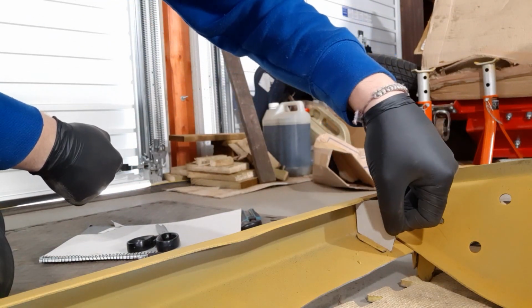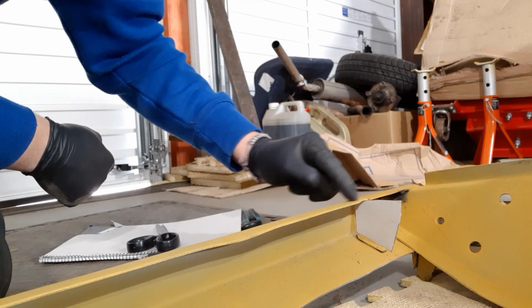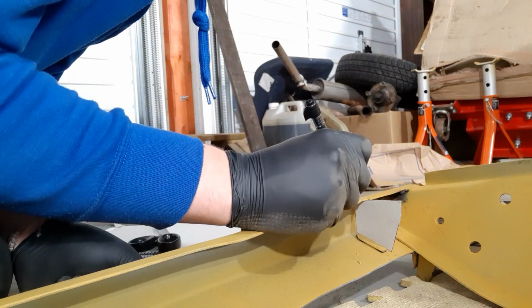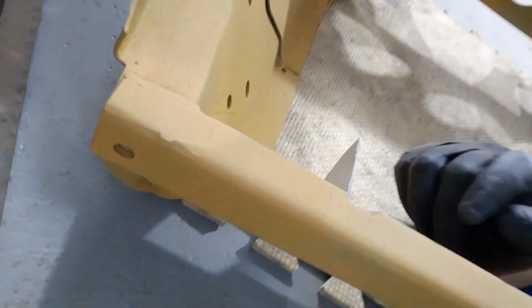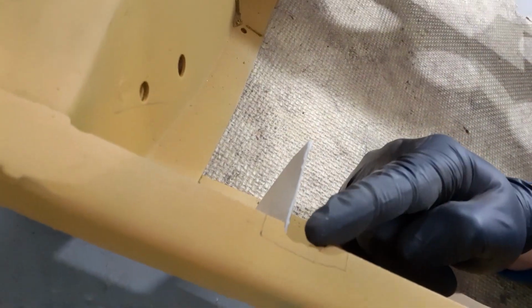So I'm going to cut some metal to this size. I'm going to cut out a section here, mark it out with this pen. So you can see this is the section I'm going to cut out and then replace, because that's obviously broken and snapped. I'm going to extend it slightly out here. The bolt hole's going to be in the middle. I'm sure I've got a lower engine steady over here that I can use as a guide for how big it's going to be. Once that's cut and welded in, that is the repair work done. Then it's just over to prep, paint it, rebuild it, get the old subframe out, fit this one in, engine in, front end done.